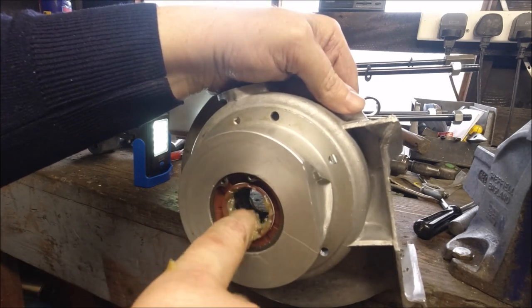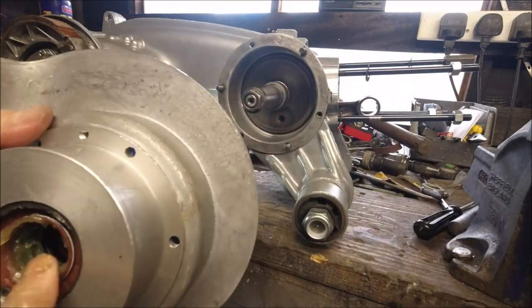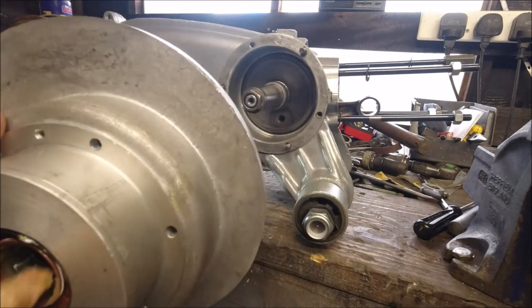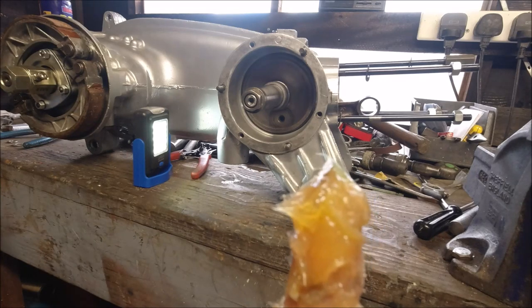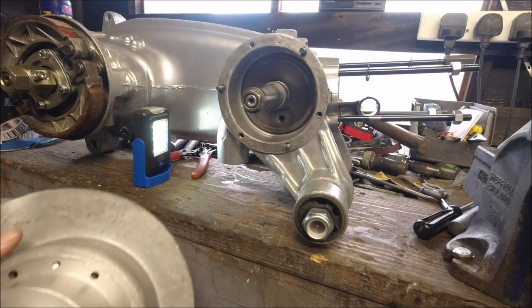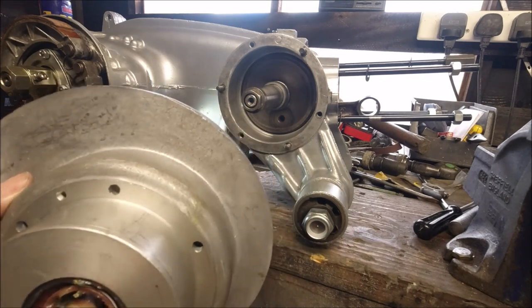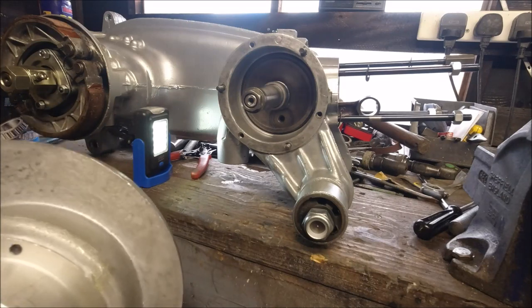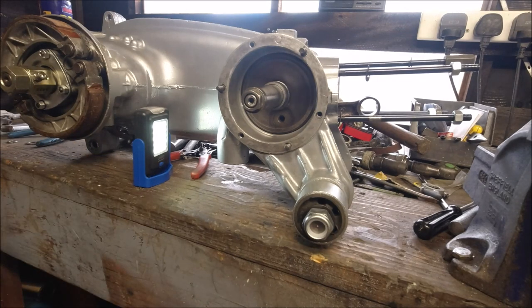Turn your bearings as well when you're doing this so there's no air. We also need grease on this bearing edge so it will just go over the crankshaft. I need a tad more - about that much more, because I can still see on the edge on the inner. That's perfect. Running around, just take some of that off, put it back in there, and get a rag and wipe my hand.